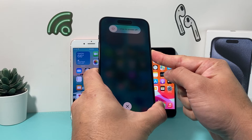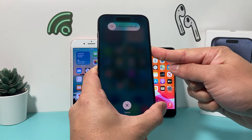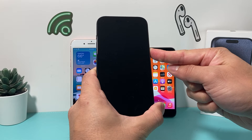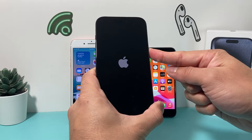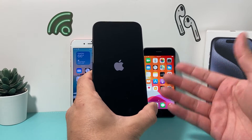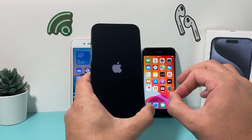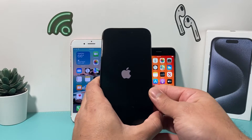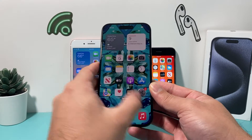When you press volume up and down, make sure it's quick. Since we're not touching the screen, we just keep holding that side button until the screen goes black, then wait until the Apple logo appears, and at that time let go of the button. That has restarted the iPhone 15 Pro. This method will work on iPhone 8 and above, even the iPhone SE 2nd generation.